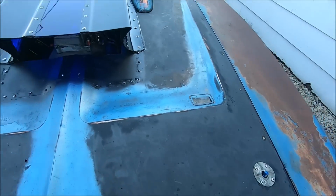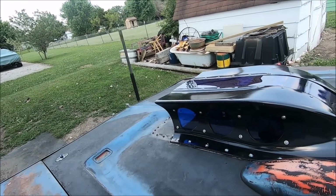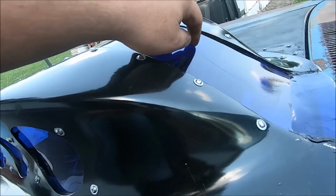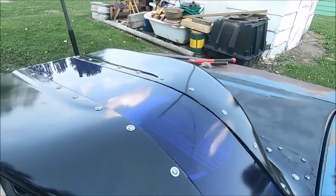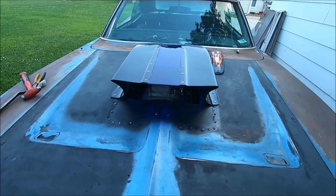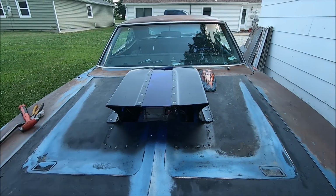Well, the air cleaner hits right where I showed you. Right now I had these little cork gaskets that seal the air cleaner to the carburetor, which I need to have, but literally they're like 1/8 of an inch thick. And that's literally all the clearance I need back here. And I bet you right now it is just barely touching right in there. But we're gonna change out the carb spacers from these big 1-inch aluminum ones, which I don't like, and we're gonna go to a phenolic wood 1/2 inch spacer. Those are on their way. I'll have to redo a little bit of the fuel line probably, but that'll make everything sit down lower. That'll give us more room to play with.